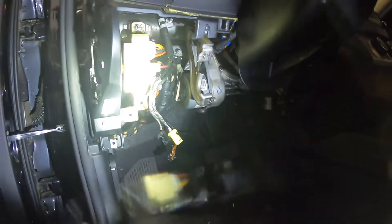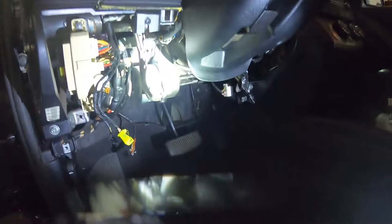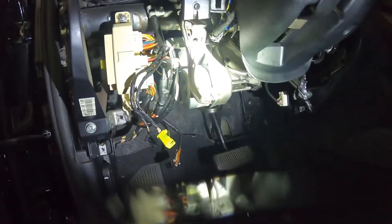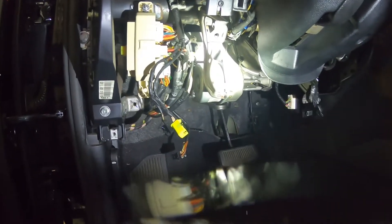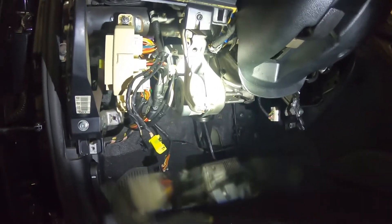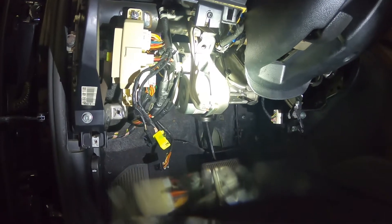Welcome back to Kevin's Mobile Repair. 2017 Hyundai Elantra — if you have a steering wheel click, click, clonk, clonk when you're turning and you hear it in the steering column, these things have a bad problem with the plastic motor gear for the electric steering. It basically just disintegrates and looks like a piece of rubber when it's done. That's what we are replacing today.